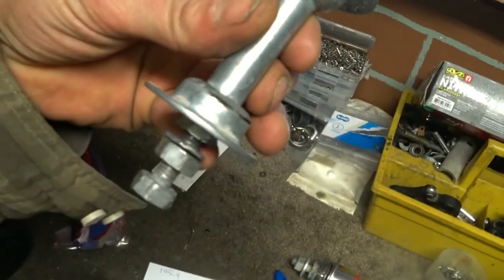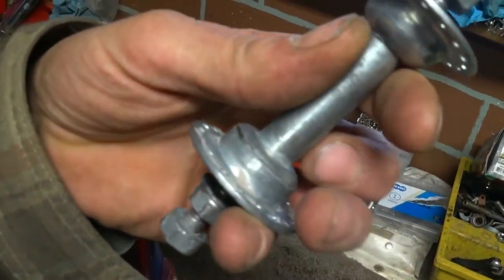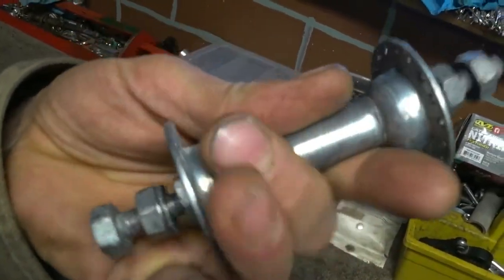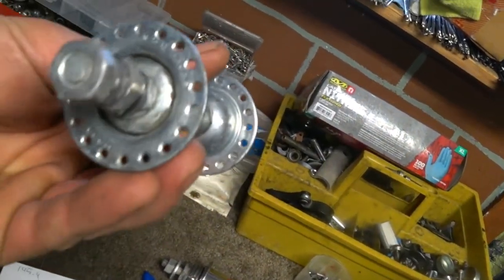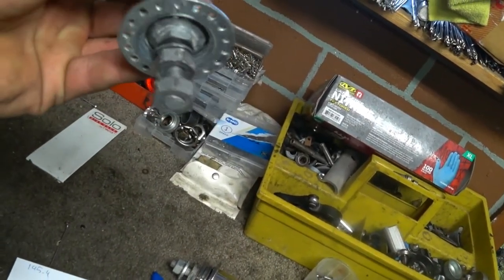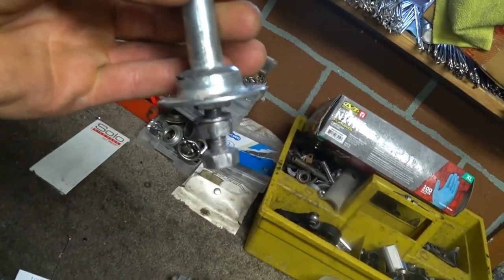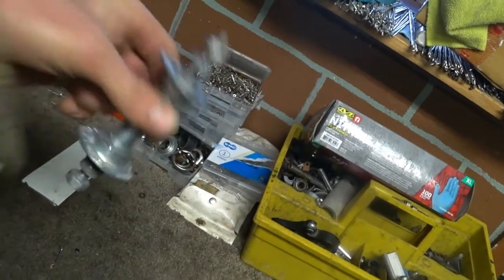And the front hub here is totally trashed. You can see that it's cracked all the way around from excess bearing pressure, and it was about to grenade, and wow, both sides even, there's cracks all over the place. So we will not be reusing this hub, but that's okay, because I have a whole bunch of front hubs and much better ones, in fact, and that'll look just like this. They're not much different, but this one is definitely trashed, so we'll be throwing this away.